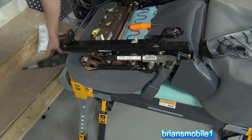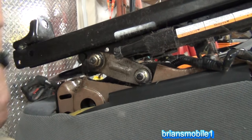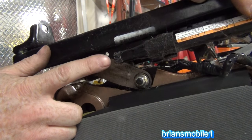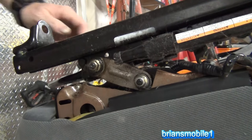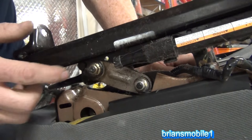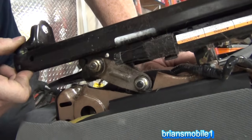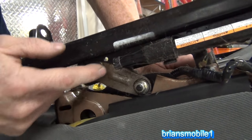Nothing like not being able to put something together because you've got one stupid screw missing. Now that we have access — bear in mind if you have a gun and you're aiming at something over here, a slight movement that much makes it clear over here. So what I'm showing you is the effect of leverage or angles — it causes this tiny movement here to be a big movement further down. Watch the movement between this link point here and this one here — the play you see in this one translates to everything.